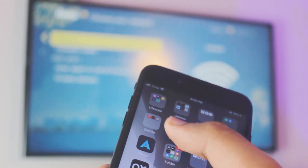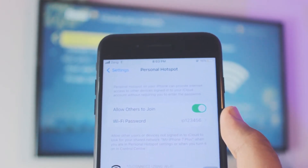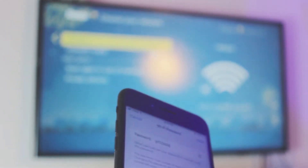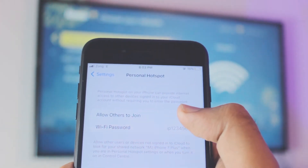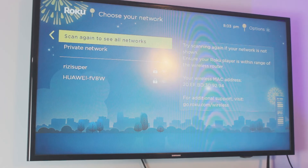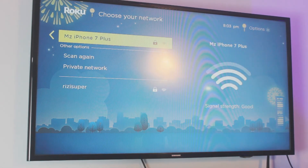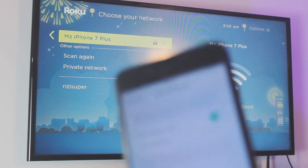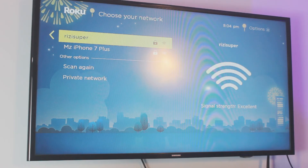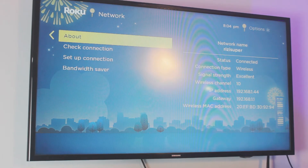If you don't have home Wi-Fi, you can use your iPhone to make a portable hotspot. Go to the Personal Hotspot settings and make sure your personal hotspot is running. Be careful though — this will use your mobile data, and depending on your network and where you live, this will cost you credit. I would still recommend using your home Wi-Fi. Once the hotspot is running, click on 'Scan' and it will automatically scan for all connections. As you can see, that's my iPhone 7 Plus. Enter the password and click 'Connect,' and your TV is connected to your network.